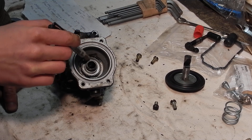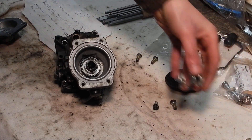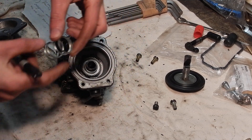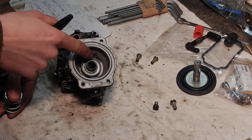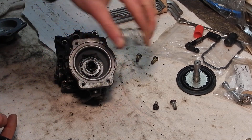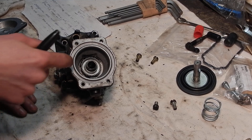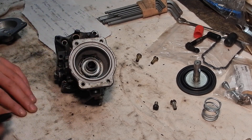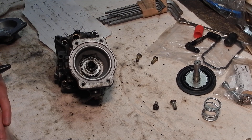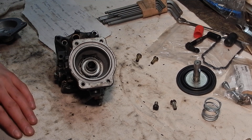The last thing I'm going to do is turn the star wheel up a little bit — that's this gear-looking thing over here. What the star wheel does is it's a rest for the AFC spring, and this spring pushes against the fuel pin and diaphragm, allowing it to move up and down. When you turn the star wheel up or down, you adjust the amount of preload on that spring, so you need either more or less boost pressure to push down on the diaphragm against the spring. Turning the star wheel up — counterclockwise — increases the preload, which requires more boost pressure to push the fuel pin down.